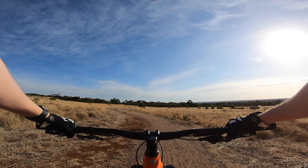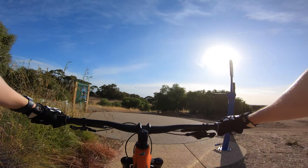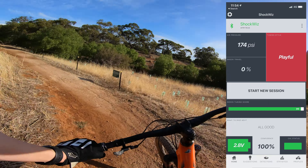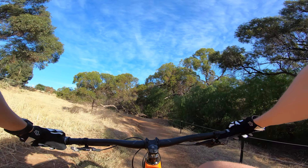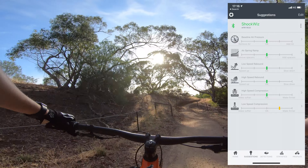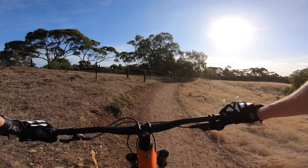So I've gone for a ride at Cobblers Creek just after work — nice, cushy, low pace. Before I got here I made the changes after another ride at Eagle Park, and what it wanted was softer low-speed compression. I thought it was pretty close, so I only went one click out of the 1–2 clicks it recommends. A ride at Cobblers Creek — and Cobblers Creek is not that rocky, a couple of features but otherwise nice flow. And it's gone back the other way, wanting low-speed compression to be a bit harder to stop that bob. That's probably the climbing up the fire track. I'm still in a playful mode because I want to be using all my suspension, so let's give that a shot, go back to Eagle Park and see what happens.